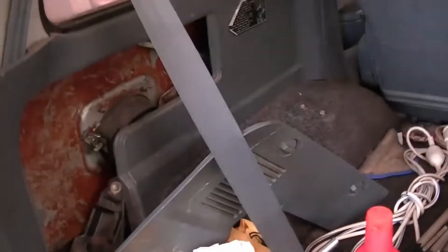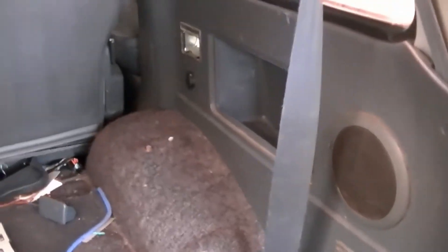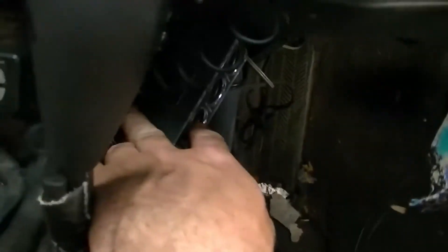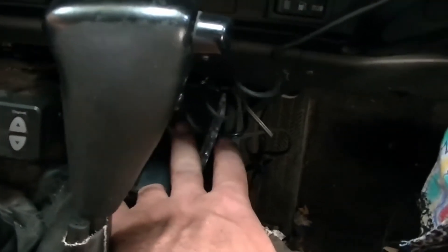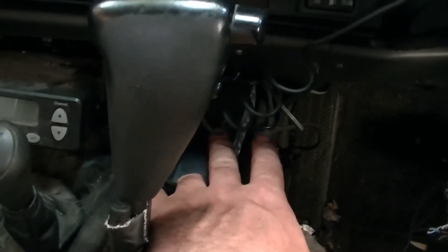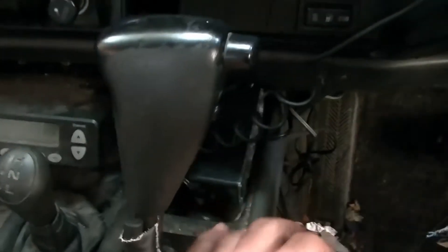Liners are back on. I've just got to put all my fluids back, put the ashtray back and essentially job's done. So I've now got a full power outlet there, which means the fridge isn't going to throw a fit. The problem I've been having with the fridge is that this thing down here is limited on current - when the fridge goes to start up, it can get the voltage but it can't get the current, so it sits there and throws up a power error. So there we go.